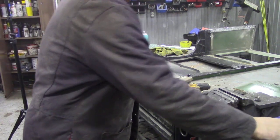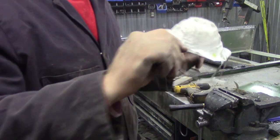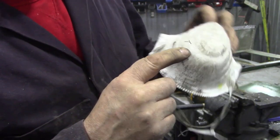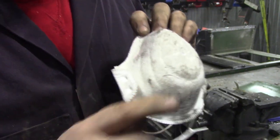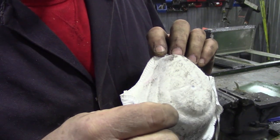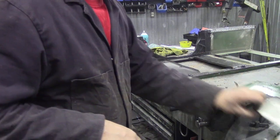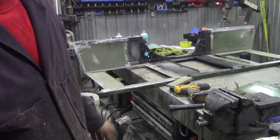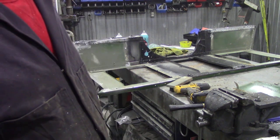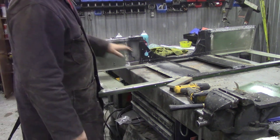Even I felt one or two little - look! Look at that! A bloody thing stuck in my mask. Exactly my point - these things are nasty. Imagine that going in your eye. Not very nice. People don't think about it. If you've noticed when I was sanding, there'd been some caulking around the old seat box. I took all that out because if you've got a panel with a bead of caulking, your new panel might not quite match up. So it's easier to take that off rather than fighting against it.